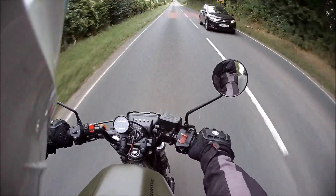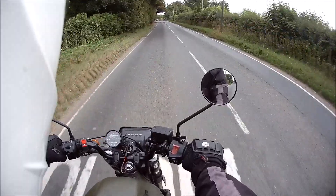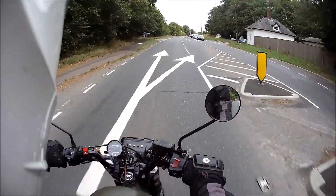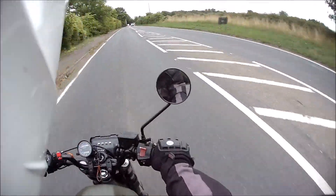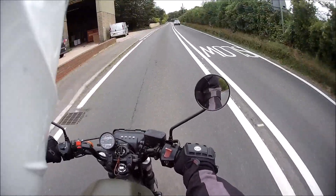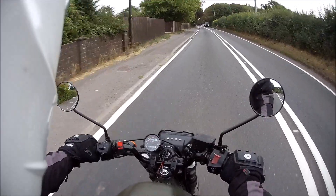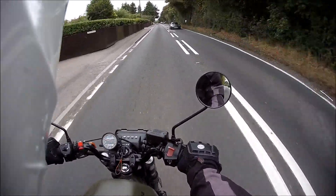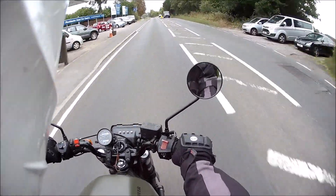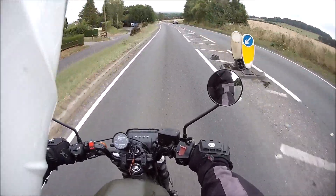Let's drop down to 50 — 80 kilometres is 50 if I'm not mistaken. I adjusted the pre-tension on the rear shock yesterday, tightened it up a little bit. It seems to have worked loose completely down to the softest setting, so I'm going to need to look at that. There was one chap on the DeVille group who asked a question about his adjuster not clicking anymore — a few of us said it's fine. Mine doesn't click either, and I've got a feeling there's a little plastic ratchet piece in there that's come out and it's unscrewed itself.